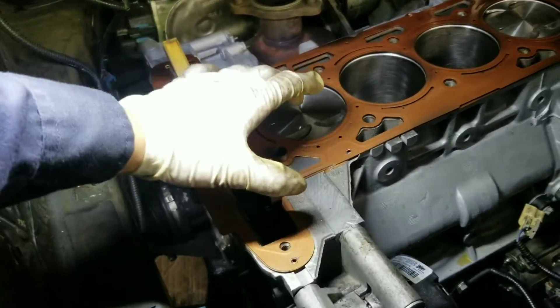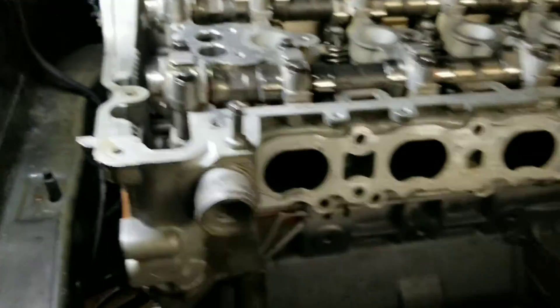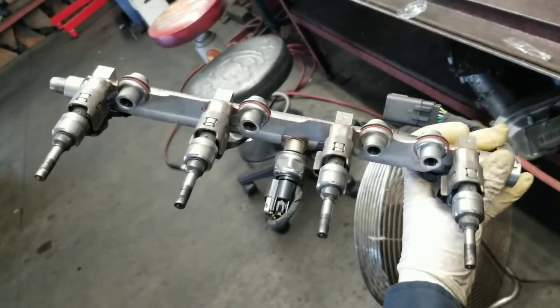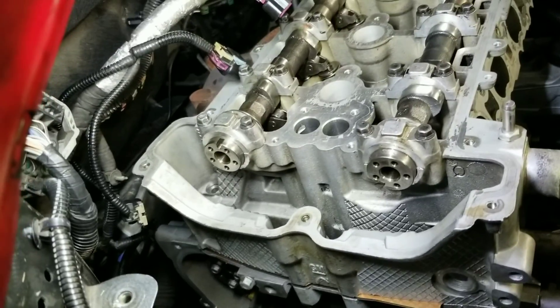So now at this point I'm ready to install the head. I'll remove the guides so it can be easier, then install the head. Okay, the head is in — good. I'm going to drop in the head bolts, then the injectors — fuel injectors. It's going to be one piece. Let me show you the exhaust — see the exhaust, right in. See, that's what I told you: leave the exhaust manifold on, it just rides right in nice and easy. So now I'm going to put the guides back in and then the timing chain, and I'll show you the marks.